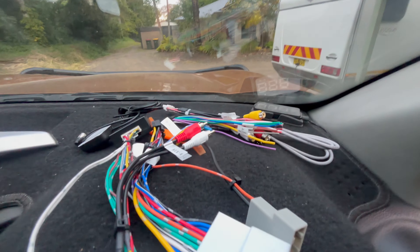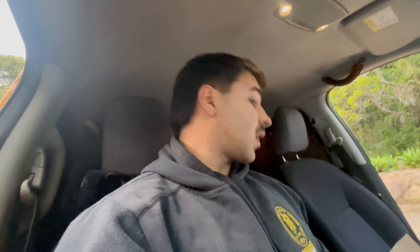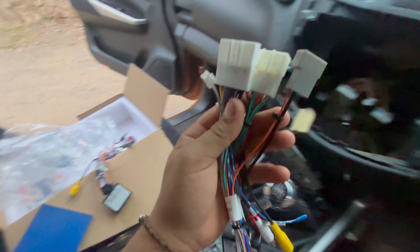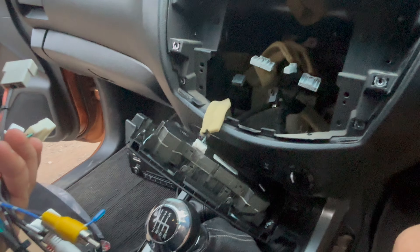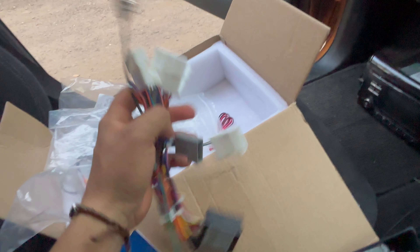I'm literally just opening everything and getting it all out on the dash. It looks like it comes with a camera — if your car doesn't come with a camera, this is compatible with it, but the nav does have a reverse camera so you should be all right just to plug it straight in. I've identified basically two of the same harness, but this one has the same amount of plugs and the same type of fittings. What I'm thinking is that this black one is going to plug into this black one, and then all this is going to plug into that — it's like a little bit of splicing, just two kits in one, like adapters. We'll give it a go and hopefully she should power on.